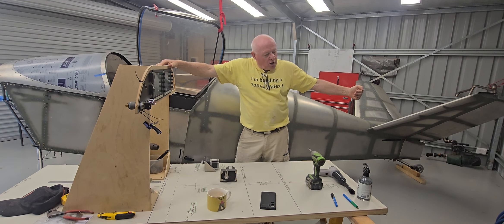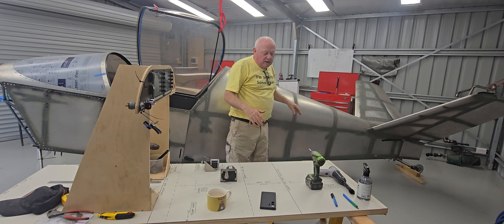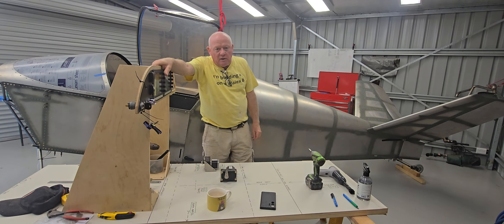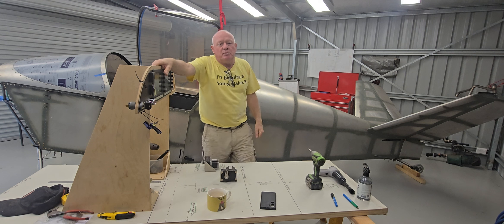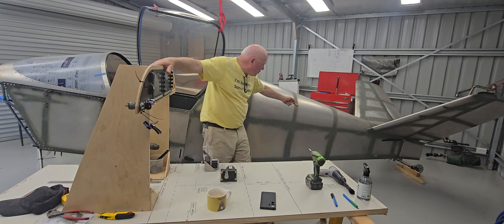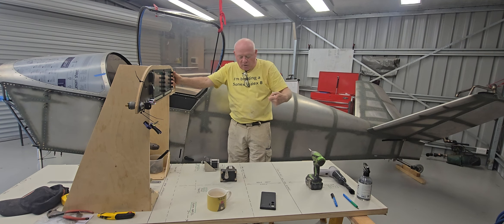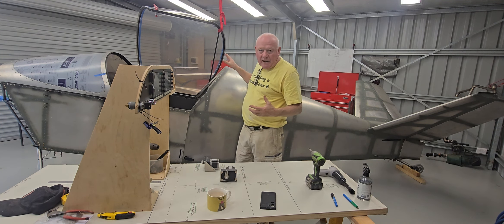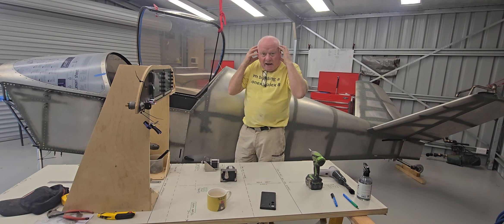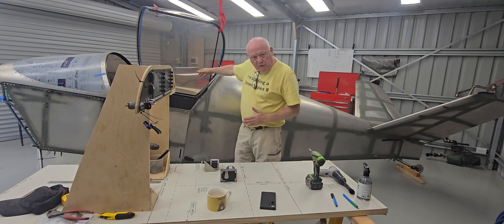MGL assure me that everything just follows track. So for example, at the tail end of the airplane, I've got the SP6 positioned away from any metallic or magnetic devices as best I can — after the seat belt connections. It will come along across, pick up the cross tie box, run through the cross tie box, and then pick up the transponder, the transceiver, the flap controller, and the headset jacks.